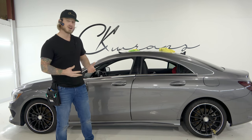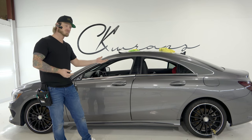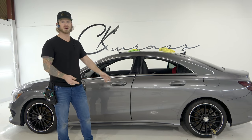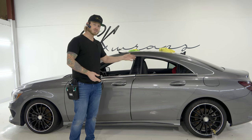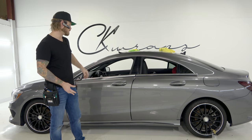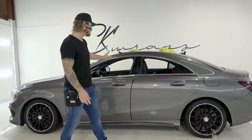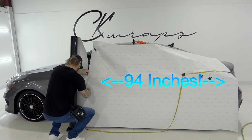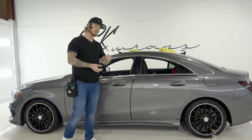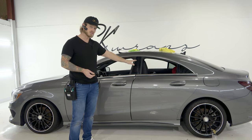First you're going to want to start off with a color of vinyl. Typically gloss black is the way to go — you could use matte or satin black, but usually black is the way to go. Personal preference, you can do this in yellow, orange, green, purple, whatever you want. We're going to roll out our vinyl and cut out sections for these panels. The longest piece is the chrome trim along the top, which required about 90 inches. The gloss black of my choice today is Avery Obsidian gloss black — it's very black, looks great, and works very well for intricate details like this.